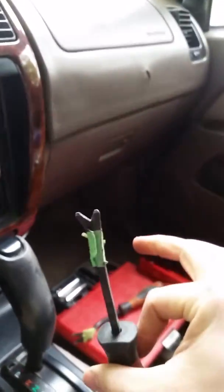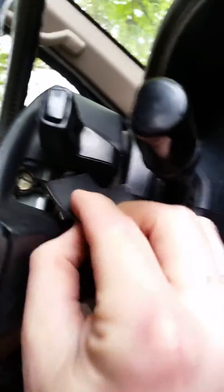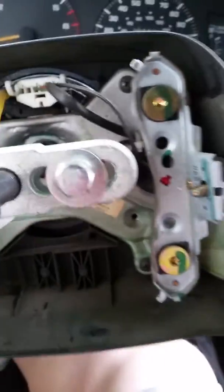...this little clip right here. You pop that off using some kind of a trim tool. Then you have this same thing right there — you pop that off too. Then there's a screw with a star head in there. Take those out; you just loosen them out, and they have little pins to help hold them in with little plastic clips.